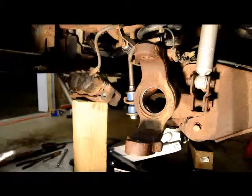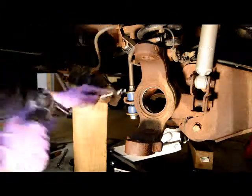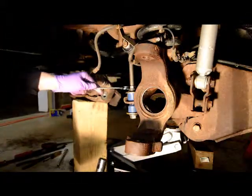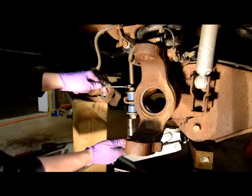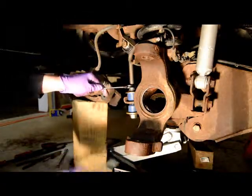I'm sorry — when you are torquing the bottom so it doesn't spin, put a backing wrench on right here, and you would torque this to 59 foot-pounds.